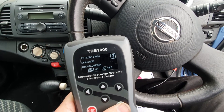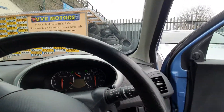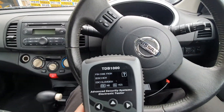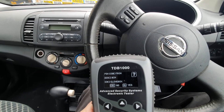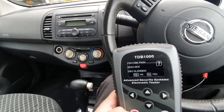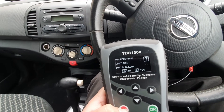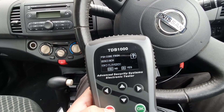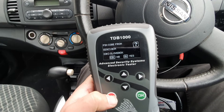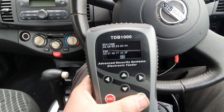Now, on Nissans, this is what you need to pay attention to. Nissans have a pin code in the glove box and they also have a pin code on the BCM. Usually I go with the pin code from the glove box — you put the pin from the glove box and it converts it to the pin code the machine will use. But I usually try the BCM first because it's easier, and if not, then I go for the glove box. So let's go BCM — BCM code gives us the pin code.